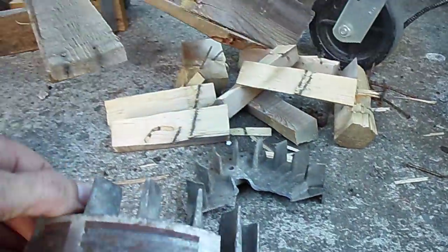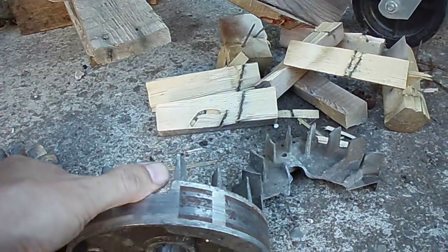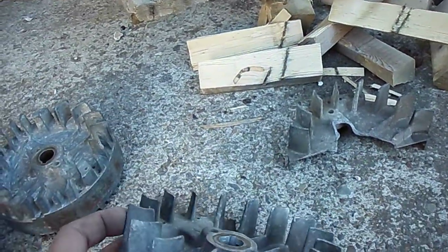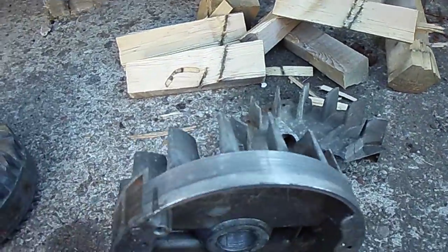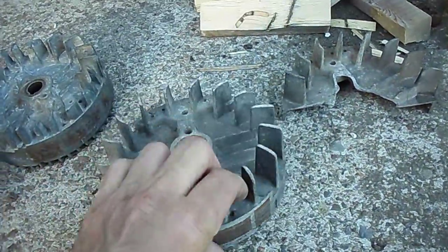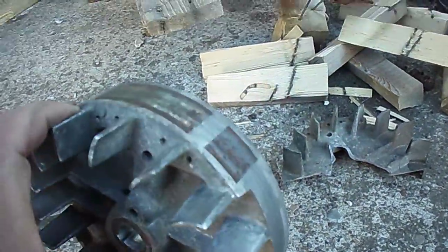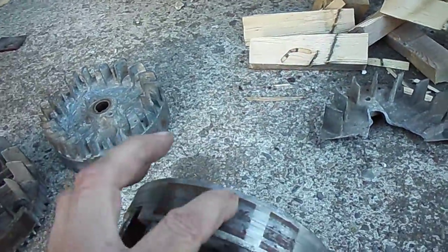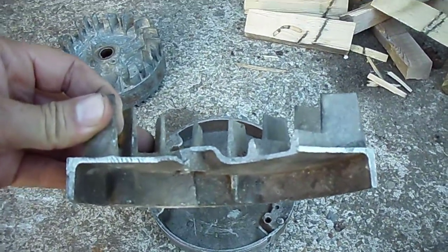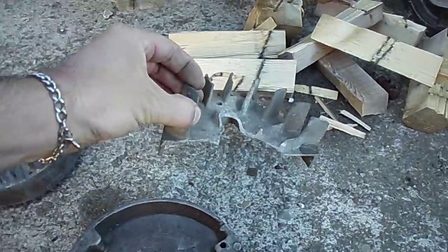In the 90s, when they went to blade brakes and put the pull start on the handles with that bar you've got to squeeze for the blade brake, they had to go back to full circle flywheels, so they're somewhat heavier. I still don't really recommend running the motor without a blade. You've got the magnet on one side and the counterbalance on the other. I happen to have one here that's cut apart - as you can see, they're not very thick, I'd give that an eighth of an inch if that. There's not a whole lot of material there.